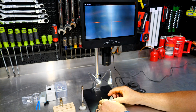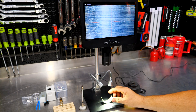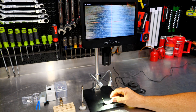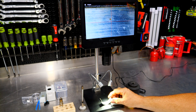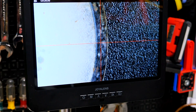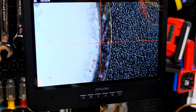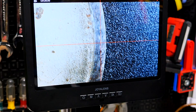You can see it on tooling, bearings — put this bearing in here and now I can get a real close look at the actual scarring on the bearing surface. Let me get some light down there. Now we can see if we actually have any damage on the bearing, and you can start to compare what normal wear looks like. We can see imperfections in the bearing face right there. And even valves — what may look like a great valve face, now all of a sudden we can see imperfections in that, and see well maybe we need to lap these, or after we lap them we can still see if there are imperfections still in the sealing edge of that valve.